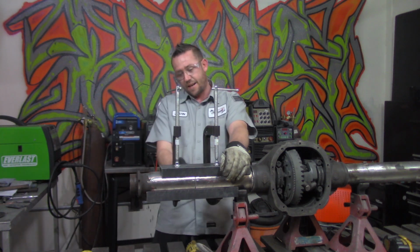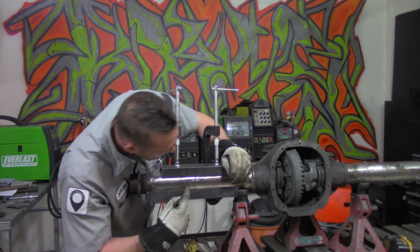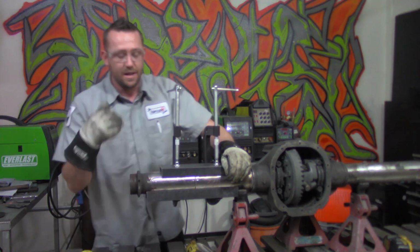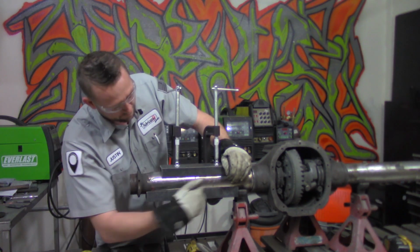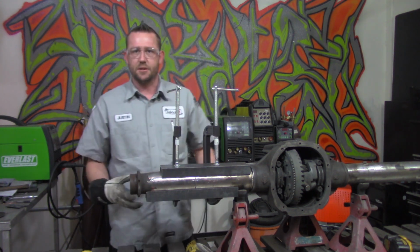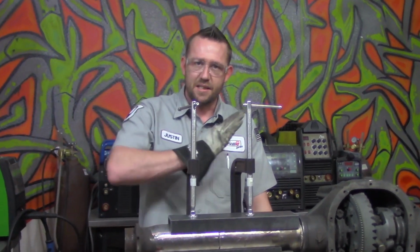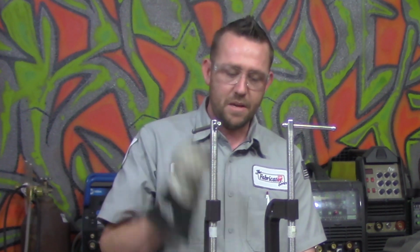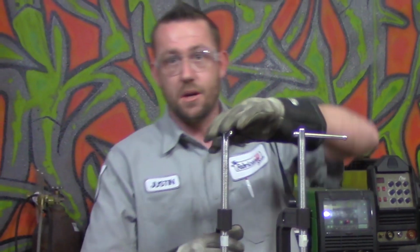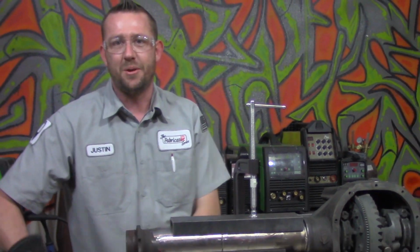On the back side here, I have a little bit of a gap. On the front side, or the side that you guys can see, it's not much of a gap. So I know that about a 1/16 of an inch can come out of here, and pretty much the same around all areas and all sections of it. I can get all that cut out of there, and that's exactly what we're going to do. Nice and easy. Do this as many times as you need to in order to get that measurement as close as possible. Don't get greedy on it, because we don't want to fill in a gap, and we obviously can't make it too short, because we end up scrapping the whole project.